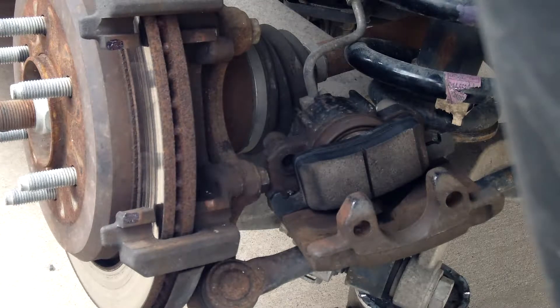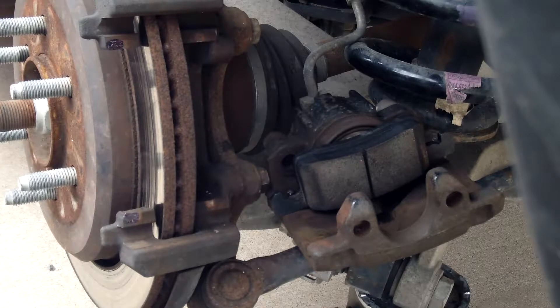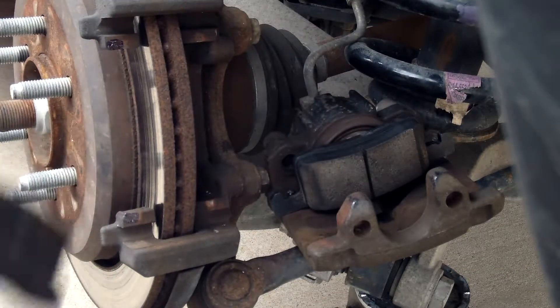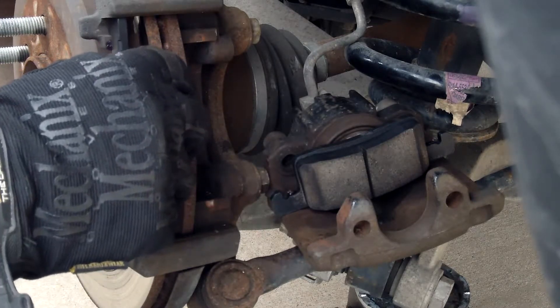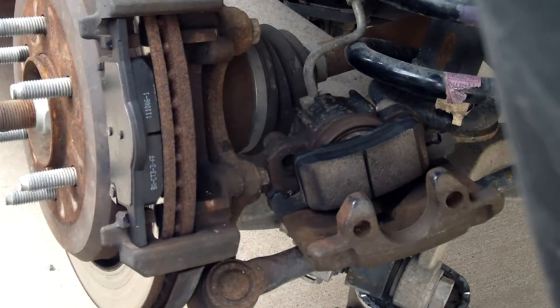As you can see, I got the new brake pad in back here. One thing I like to do is use some of this Syl-Glide grease. I like to put it right there on the wear points where the pads are actually running. I got the other pad here — already got it lubed up. I got it on there and it just makes it glide a little bit easier. I also like to put it on the pins — it just kind of helps with brake noise. So I got both of them in now, ready to put it back together.